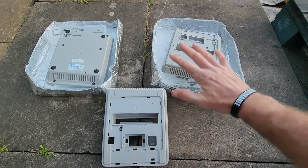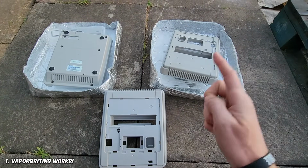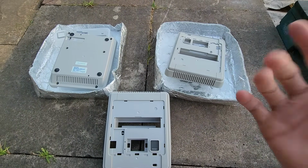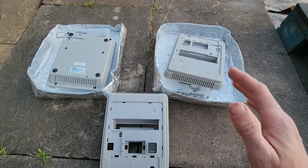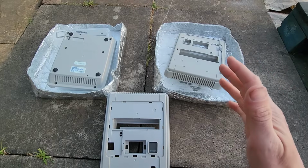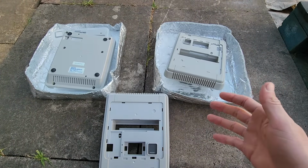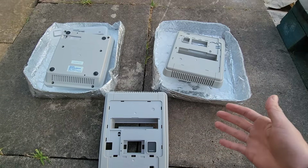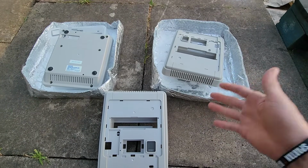Okay, so what did we learn from all of these experiments in this video? Number 1, Vaporbrite works. Vaporbriting works. Number 2, Vaporbriting is a slower process, but it doesn't require submerging your items, so it's beneficial for delicate items. The benefits of it being slower are you can check on your item periodically and pull them out when you think they're done. It's harder to leave items in for too long.